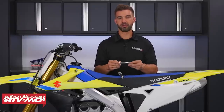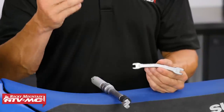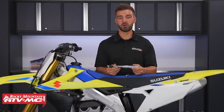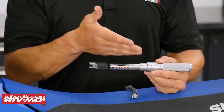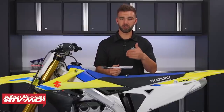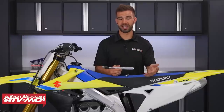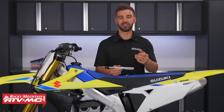There are a couple of tools you can use to adjust your spoke tension. The first is the one that comes with just about every motorcycle — these do the job, however the hard part is you don't know how much torque you're using. What I always recommend is a spoke torque wrench; we have a couple to choose from on our website. The great thing is you know you're using the exact inch-pounds recommended for your spokes, so you're not over-tightening or under-tightening. That's my third tip — make sure you're checking your spokes and tightening them if needed.